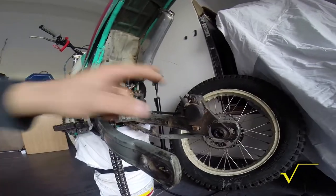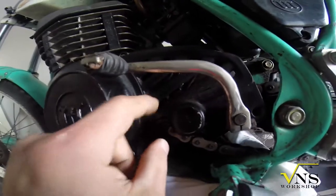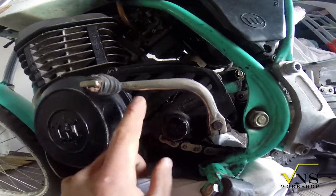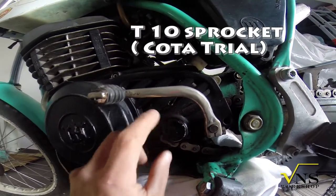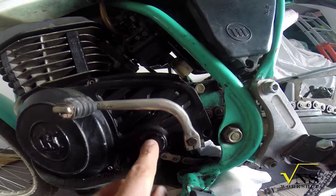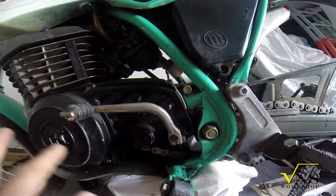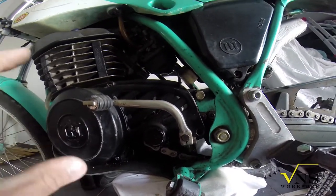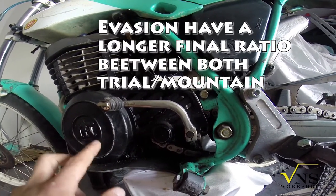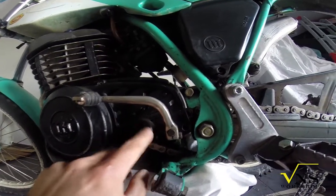With some difference, here you can see I changed the main gear ratio. With this smaller gear it's very similar to the one mounted on the Montesa trial, and now the gear is quite specific for trial. I like it — some difference between the first three gears, but with this modification I can feel the difference.